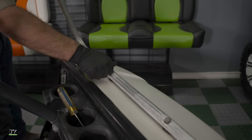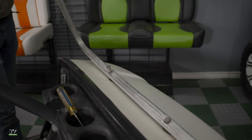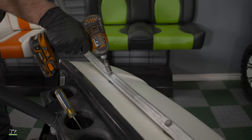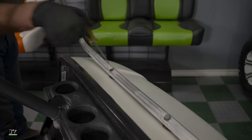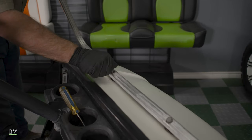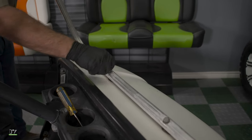Now that we have it apart, we can reattach the front U-bar back to the golf car. Since the U-bar is actually mounted at an angle, I usually use a Phillips head screwdriver through one side of the framing to hold it in place so that I can use a bolt inserted on the other side, making it easier to align.